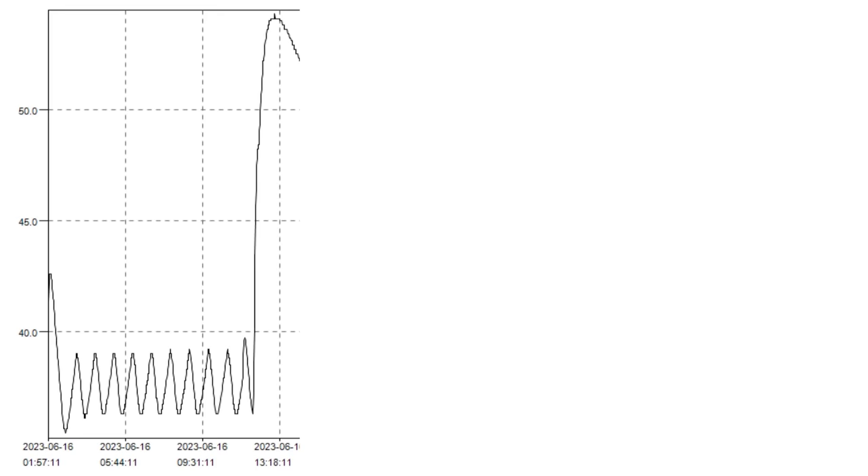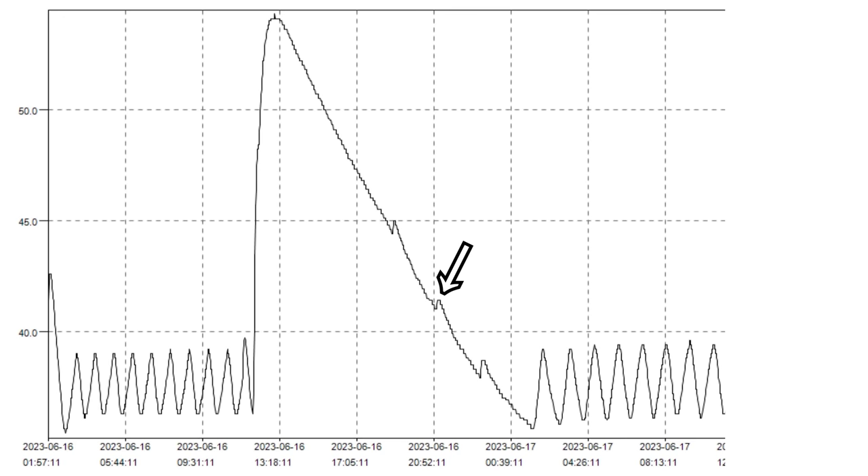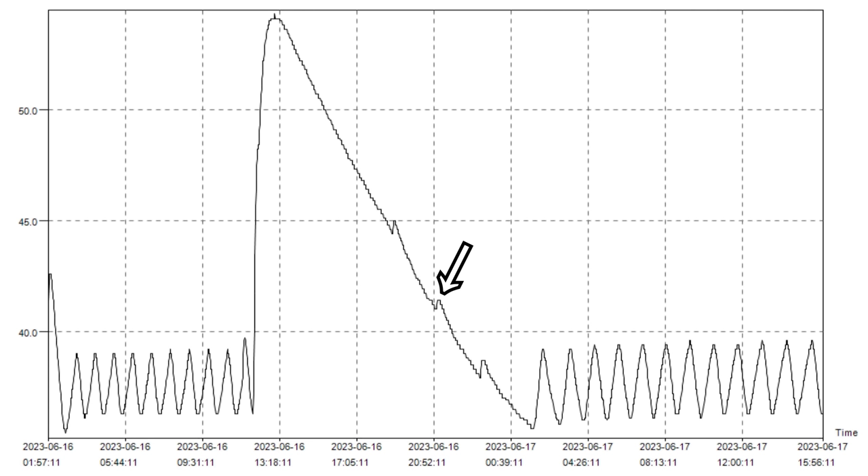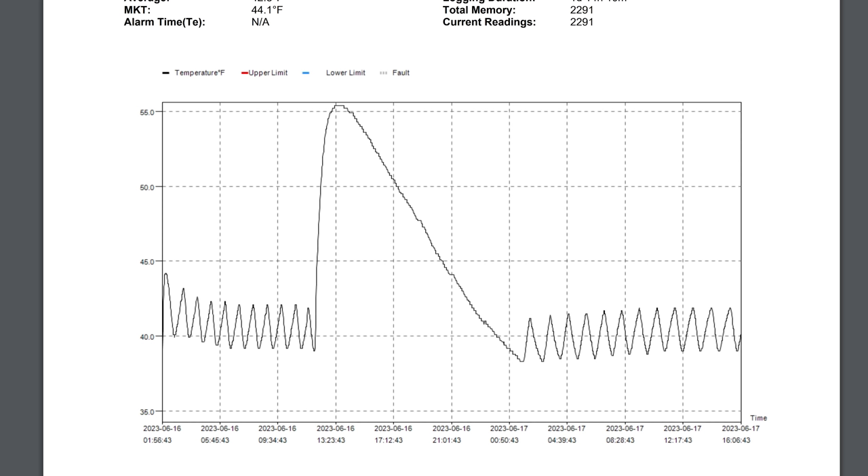Next, it was time to repeat the soda test. I loaded up all my probes again and monitored the fridge empty for a while, then in went the soda cans. As before, it really, really doesn't like doing this — it took 14 hours to dig its way back down to the setpoint. But it didn't stop until it got there. These little blips here are me checking on the temperature probes a few times to make sure the new controller's displayed temperature wasn't wildly far off from reality. But had I not opened the door, this would have been an essentially straight line all the way back down to 38 degrees. This is how a refrigerator is supposed to behave. When it's too warm inside, it kicks the compressor on, and once it's cold enough, it shuts it off. It shouldn't matter what you put in the fridge — it should just do it. And in this data we can actually see the widening of the cycle times now.